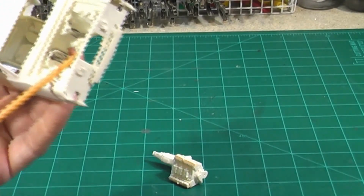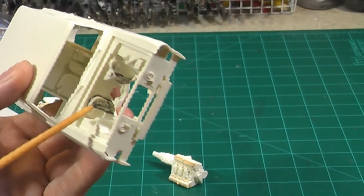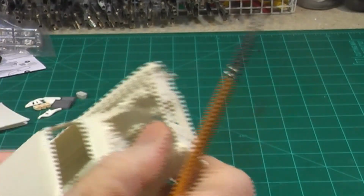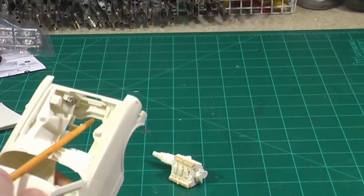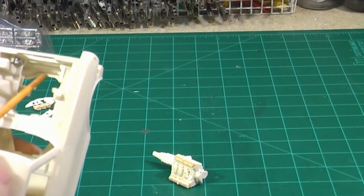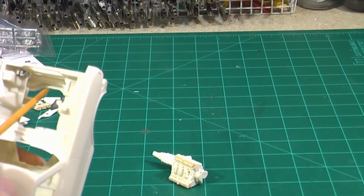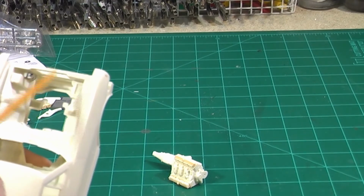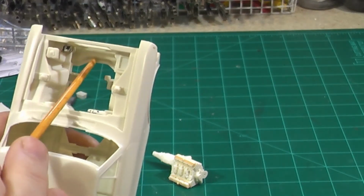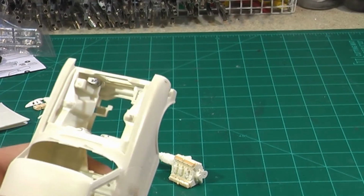But yeah, as you can see here, helps if I stay in the camera. I got that and that. I'm going to have to do some modificating there, and probably like they did in the first mid-year Corvettes in '65 when they started putting big blocks in, they had to modify the front cross member a little bit. They actually redid it and bent it, modified it and caved it down in more. They just had to resize it for the lower pulley to clear. So I might have to do something like that on this. We'll see. Once I get this done and get it to where it sits right, I may not have to do that, but we'll see.